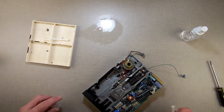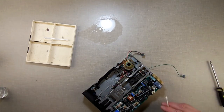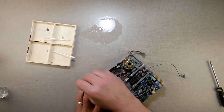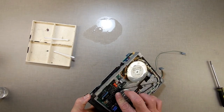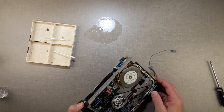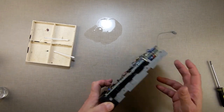That's it. That's the only maintenance you really have to do on a disc drive just to keep it going. You could blow the air out too — if you're going to do that, do it before you oil it. Now I've got a little mess to clean up, but this is running nice and smooth. I still need to figure out why the stepper motor isn't running, but that's for another day. Have a good day.